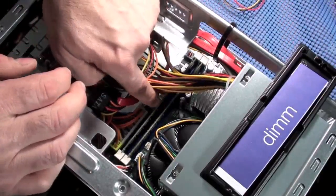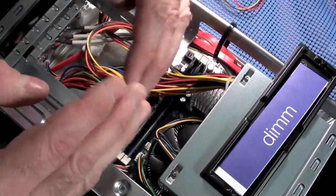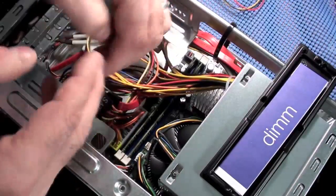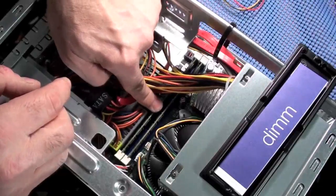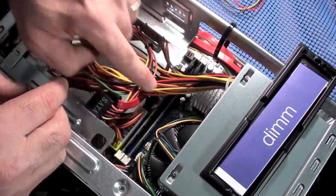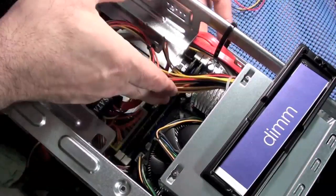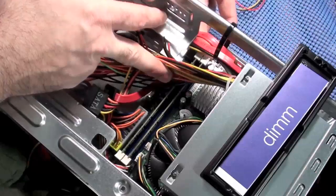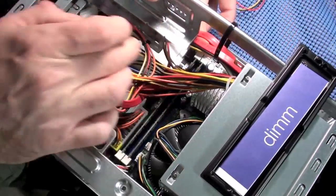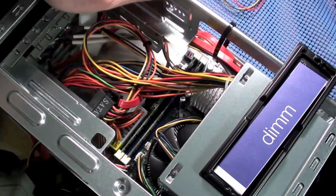like that, and then I jiggle the middle a little bit just to make sure the motherboard didn't bow down a little bit. You want to make sure of that, because that socket can flex or bend a little bit. So I just give it a very slight press and wiggle so I know it's in there good. And the clips are totally up. Sorry, I'm losing my voice. So everything looks good. I'm going to take a visual. And that's really all you have to do to get RAM into your machine.